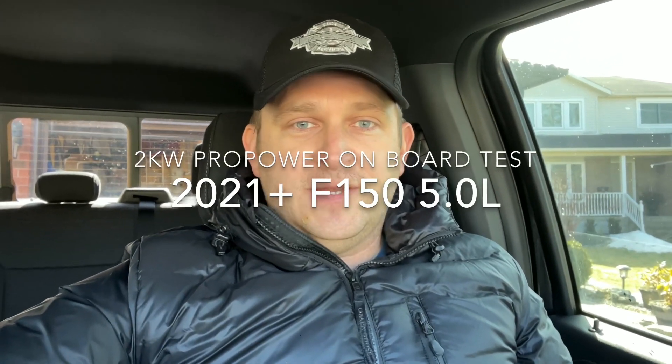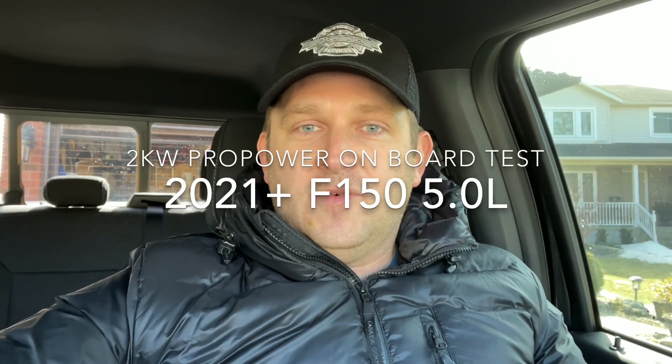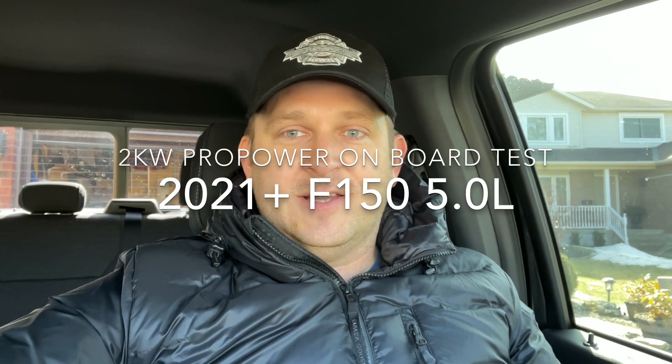Welcome back. This is my second video on my new 2021 F-150 with the 5-liter V8. I got the 2-kilowatt built-in generator in my truck and used it once while camping with my two sons. We plugged a heater into the tent as a test and it worked quite well. Unlike the 3.5 hybrid with the 2.4 and 7.2-kilowatt generators, Ford doesn't give a runtime estimate for the 2kW on the 5-liter, so I'm going to do a test to figure out how much gas it uses at around max power.